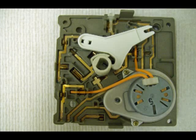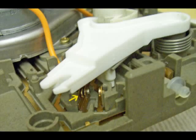My refrigerator uses a circuit almost like a printed circuit to eliminate all the wires. After running several tests, I knew the timer motor was just fine. After testing the other components, the very last thing I found cured my problem. My ice maker was intermittent and then quit working completely, and this little set of points — I cleaned these points and sprayed them with a little bit of WD-40 — and that fixed my ice maker. It has been working now for three months with no problem at all.